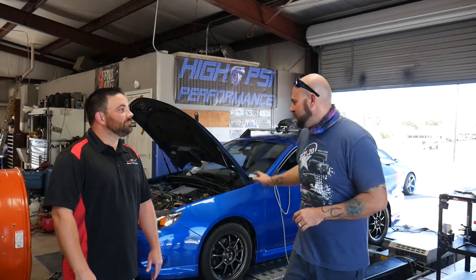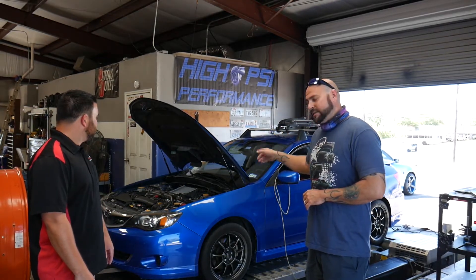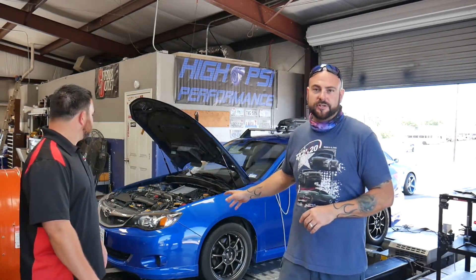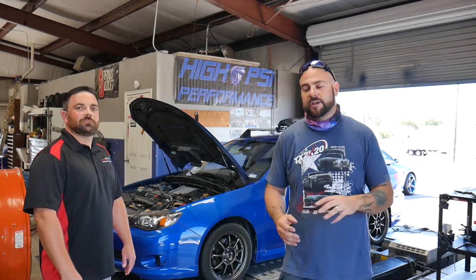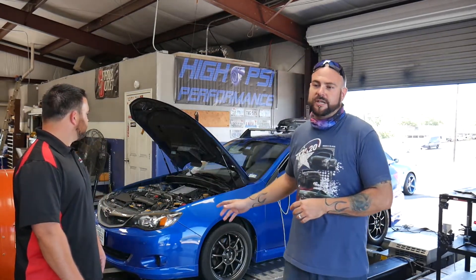Okay, so as you can see we finished up our last run — six runs total. We did three runs with pump gas and then three runs with the E85. Just a recap of this car: it's an '09 WRX, five-speed manual, aftermarket downpipe, thousand CC injectors — that's it. The car has been flashed with HP Tuners and all that has been done is the injectors have been sized and that information put into the ECU. There's been no tuning done other than that, so the numbers we're seeing are what the car would be stock with stock injectors, just calibrated for the larger injectors.